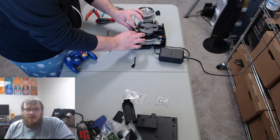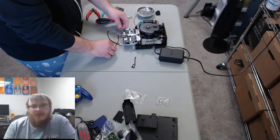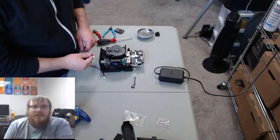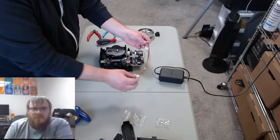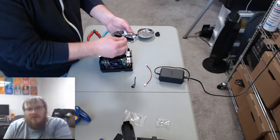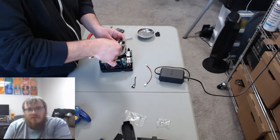Before you snap it in place, you've got your two cables that you need to plug into your board. Okay. So you've got those two cables sitting in front of you? Yes. The one that is the same on both ends goes next to the relay that's got the little red dot on it. Okay, the connector is the same on both ends. It doesn't matter which side goes in, just plug that into that header next to the relay. Upside down. Okay. Like that.